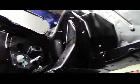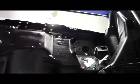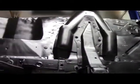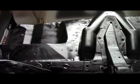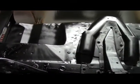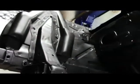So I stripped the entire front end, cleaned it all up, metal prepped it, and then used POR 15 on it. And I think it came out much, much better. I like it a lot better. I'm happy with it because, you know, there's no rust on that thing whatsoever. Not anymore anyway. There was.